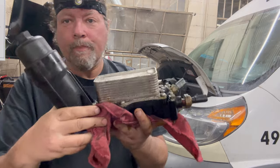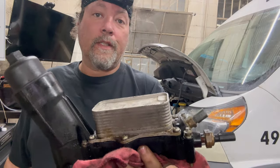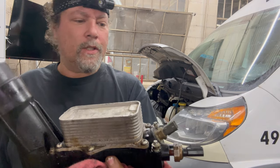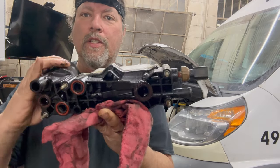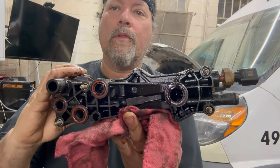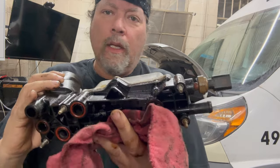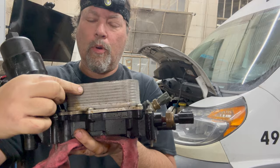This is the oil cooler in question. They've looked pretty much the same since 2011, and I think it's pretty much the same part on the '22 and up engines. It has passages on the bottom that mate to the top of the cylinder block — two are for oil and two are for coolant, and I don't know what the third one's for. This is a little heat exchanger portion.